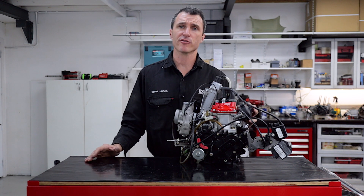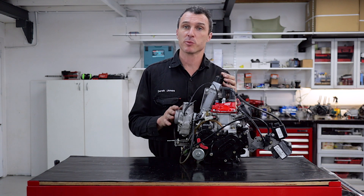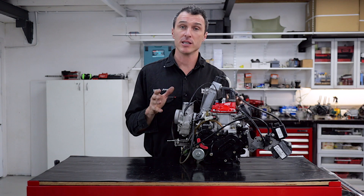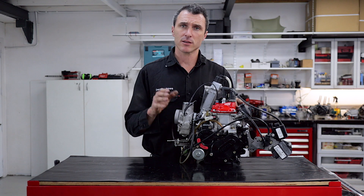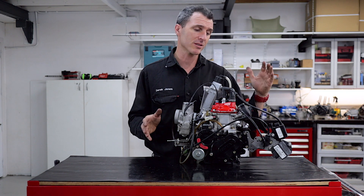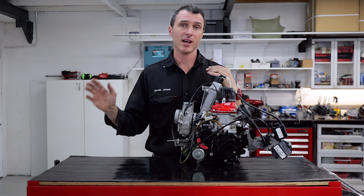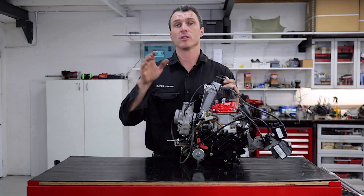This week's video was a question from our friend Jacob Jurgensen, who asked about the difference between the Evo and the Non-Evo Senior Max Rotax engine, and whether it's all just hype or there's really a difference. What I say, Jacob, is you definitely need this engine if you want to race against other Evo engines. If you had a Non-Evo you'd be in a bit of trouble, because this power valve works every time perfectly. The new cylinders are excellent, couple that with an exhaust pipe that doesn't crack and doesn't leak — it's a no-brainer. The Evo is superior to the Non-Evo counterpart, in my opinion.